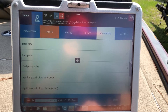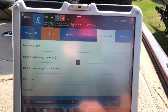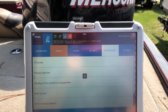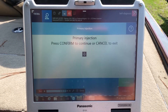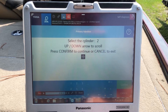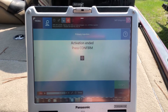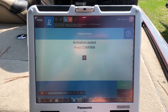Go down — all these other tests include ignition, main relay, and primary injection. I'll go ahead and do the primary injection test. We'll pick cylinder number three. You can hear a click and it's through.